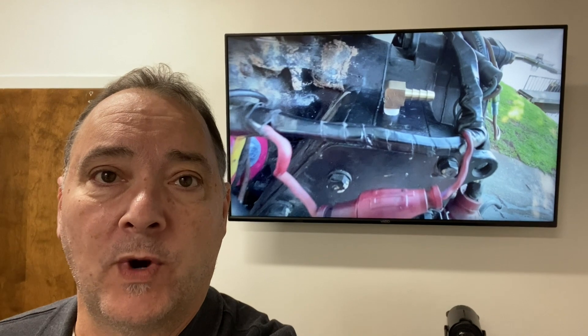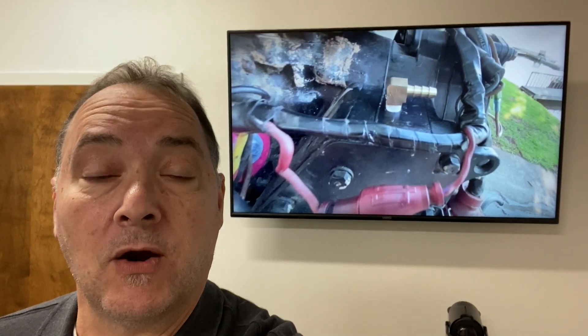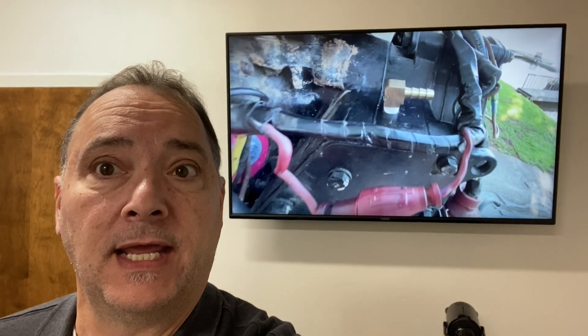Apparently there's some vapor lock that happens especially when going at low speeds, causing an airlock. The telltale blows out the bottom of the block, while the thermostat and overheat sensors are at the top of the block. Sometimes air would get in there and it would act like it was overheating when it really wasn't.